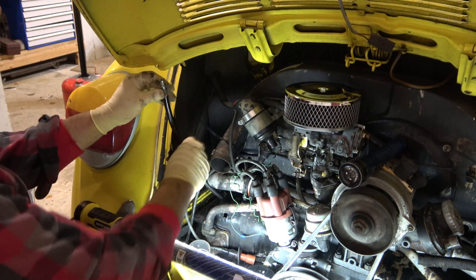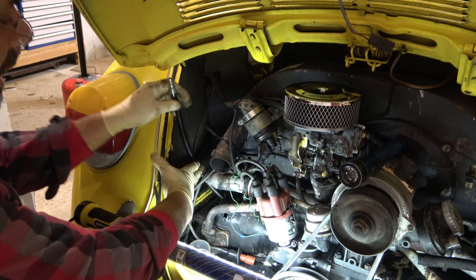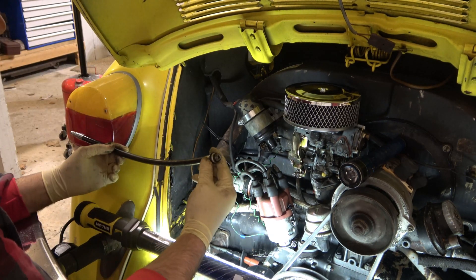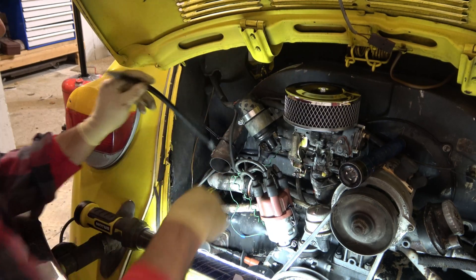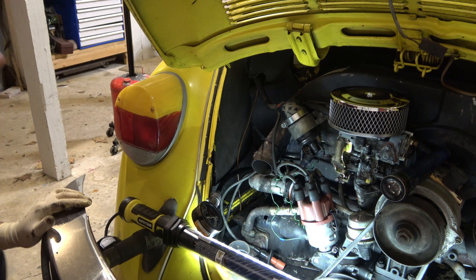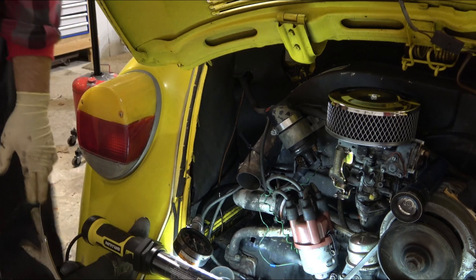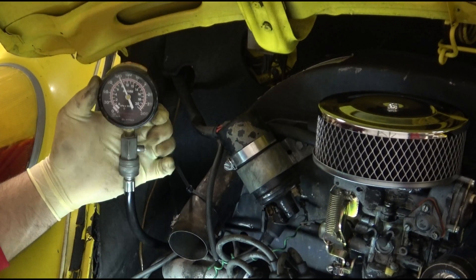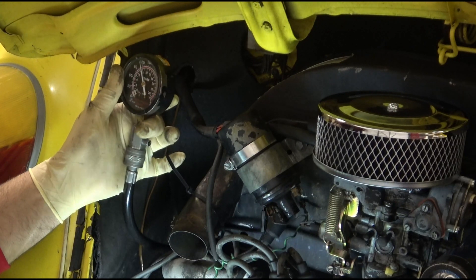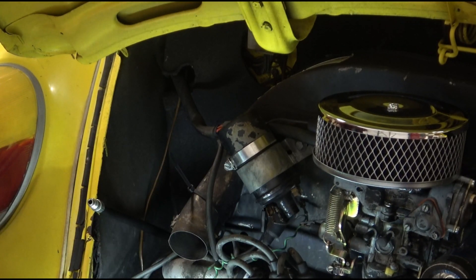Since we have it apart, we'll check the rest and see if this engine is salvageable as-is in the car. I'm going to be pulling this engine out for other reasons — going to do a dress-up kit on it. But we want to see if we have a bad ring or bad valves. I'll show you that after we're done with the initial compression test. Here's number two — I usually do eight or nine puffs per cylinder. So here we are with a normal cylinder: that's 120, and 120 is about 150 on this gauge, so we're good there.